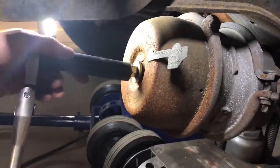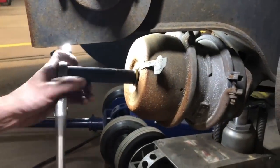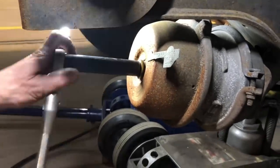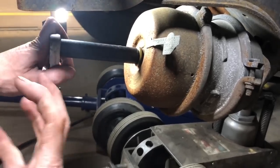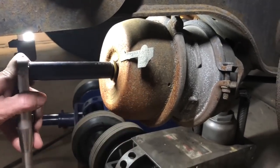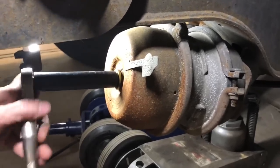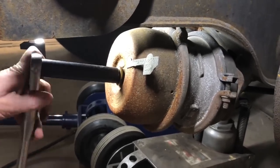This is a socket I picked up off a tool truck just for this — it's a three-quarter — I'm just doing this to save a little bit of time. When you feel it bottom out, don't try to force it; if you turn it anymore you'll bust the inside where it connects. This releases the spring pressure on that heavy spring that's in there. You don't have to use a socket — you can finish it with a wrench — it's just to make it go faster.